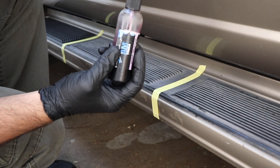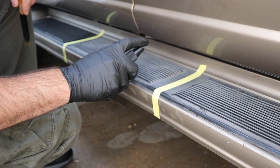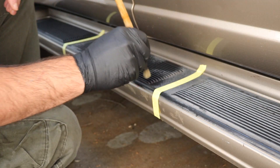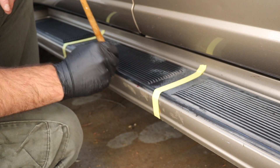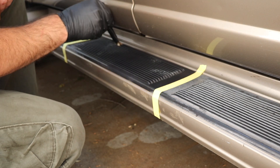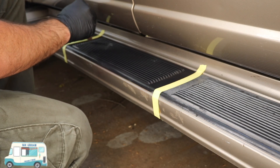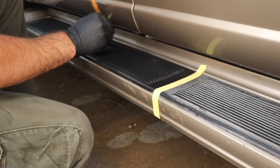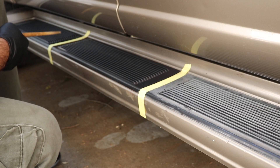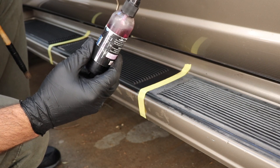That's worked into the plastic really well. Let it sit, soak in there, and then we'll wipe off any excess. Next is AM Trim. I'm going to apply it with a little brush. It has a spray tip so you can spray it onto the surface and work it into the plastic. This stuff smells really nice — kind of a grapey smell. This is solvent-based; if you get it onto the paint it will wipe off, but it is a little greasier than water-based dressings. That applied really nice — just like the Trim Serum, nice and dark, nice and rich. I love the way this stuff applies.